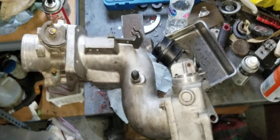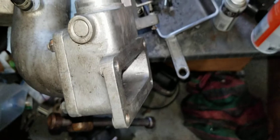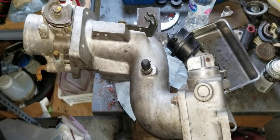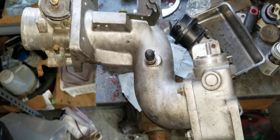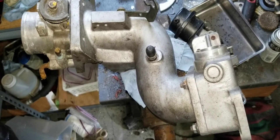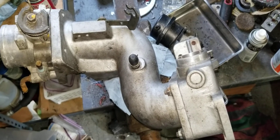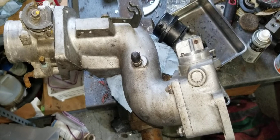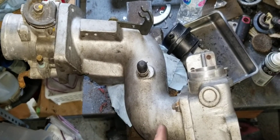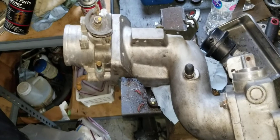Here we've got the S-tube. The air rushes in through here and hits a wall, has to come down, hit another wall, and then go into the supercharger to get compressed. There are a couple of companies out there trying to make new S-tubes, which is great — hopefully we'll see those soon. This was designed strictly to bolt onto the OEM Honda system. I don't think Moss Motors or whoever owned Jackson at the time — it may have been Jackson themselves — intended this to be more than a bolt-on 75 horsepower kit at around 6 psi. I've been thinking maybe in the future I'll cut and bring this section down to get rid of that bend, but for now I'm going to leave it alone.